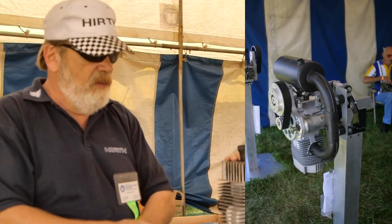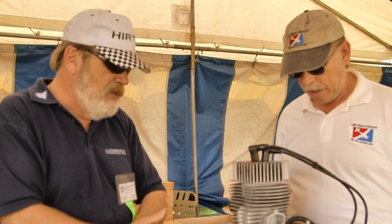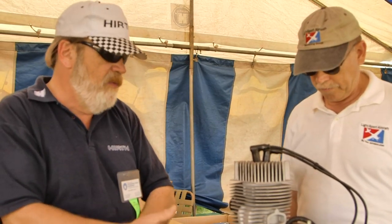This engine is 28 horsepower. Dual ignition is standard. It comes standard with recoil start, and electric start is also available — when you order it with electric, they leave the recoil on it too. It can be run inverted or upright. It's pretty versatile, and if you're trying to make a legal 103, this is one way to go. At 44 pounds, it's a very light engine — a good bit lighter than the old 277 we used to use a lot back in the day.